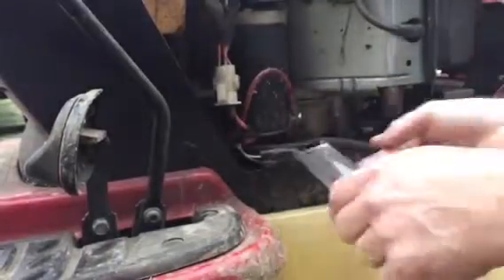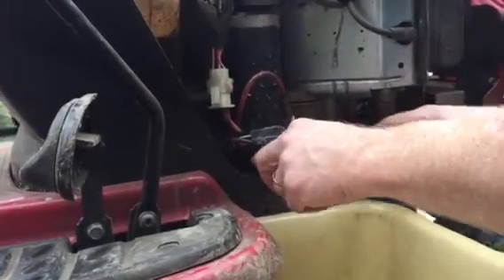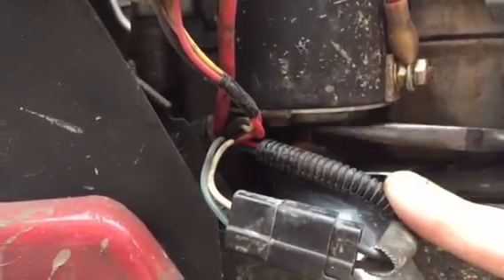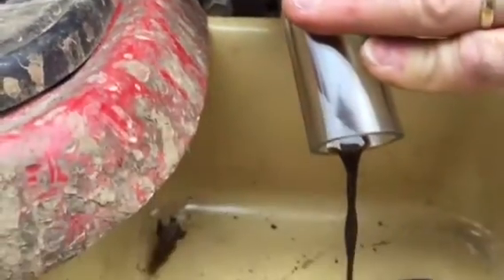You can see I have a one-inch hose that I cut a notch out of. That's going to go over underneath my drain hose right here. I get a little screwdriver underneath that hose and lift it up a little bit, and I can tuck that one-inch pipe underneath there. You can see the orange drain plug there that's tucked inside. I take a pair of needle-nose pliers and I pop the drain plug out — it comes out fairly easy. And you can see it drains the oil down into my oil pan.